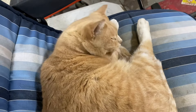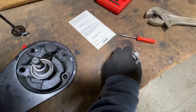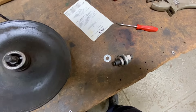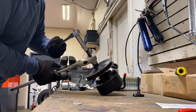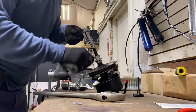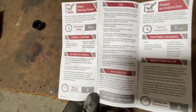Success! Now, you can't just smash this pulley on because you'll damage the pump — you need to use the puller to push it back on. Thread in one of the adapters, thread that on, and there's a little bearing that rides against the pulley. Tighten it up — holding that and turning this. Now look who's awake to help! Run this down until the bottom's out. This is taking forever — oh, I think we're there. Back it off — yes, we did it! I finally find the directions: replacement time three hours. I don't think so.